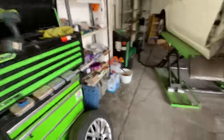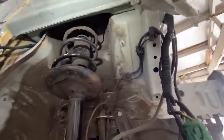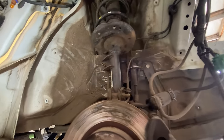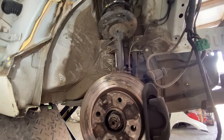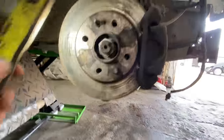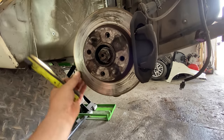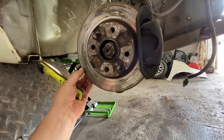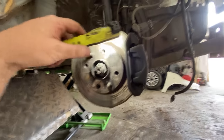I have also noticed something else whilst I was... I think you saw me doing it. You see all the dirt inside this wheel well. It is everywhere. So I just started to scrape it off and get it cleaned up a little bit better. It was terrible, much, much worse than this. And I'm doing my usual checks and stuff. Brake pads are pretty low, so we've got to change the brake pads on this. Discs are absolutely fine. There's very, very slight wear, minimal, a mil at the most, on those discs, so they can stay. We'll do the pads.